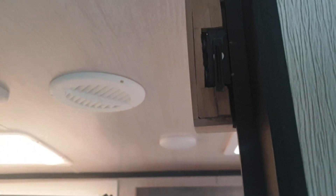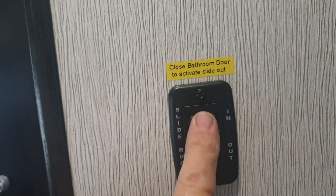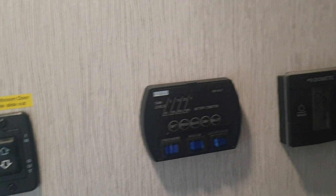Here's my switch box for the door. When the slide comes in and the door is open, it'll hit a dead stop and bend all the hinges off. To prevent that, I wired in this little limit switch — it's a dryer relay — and that wire goes into the back of the slide controller. I put a sign on there too, because right now with the door open the slide won't work. As soon as you close the door, the slide will work.